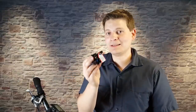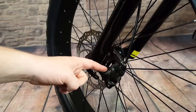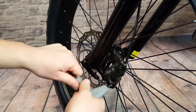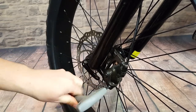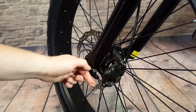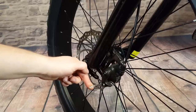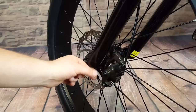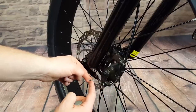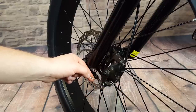It's very easy to install, so let's go ahead and take this Rad Rover I have behind me and I'll show you how simple it is to put these on. Here we are close up to the stock Rad Rover mechanical caliper. We're going to remove the caliper from the bike, loosen up the steel cable, and then remove the cable crimp on the end. You can either grab a pair of pliers and pull that straight off, or if you have enough length you can cut the cable right next to it — but you want to leave as much as possible on that steel line.